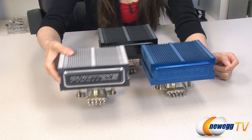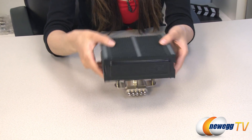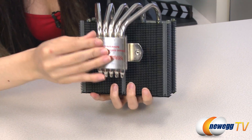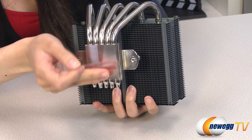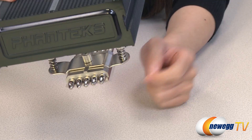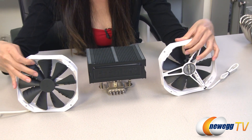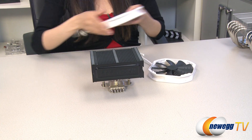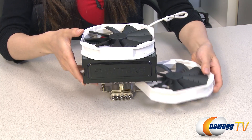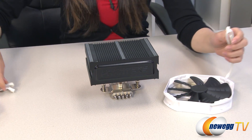Here's another look at the heatsinks and their various colors — the white one, blue one, and finally the black one, which is my favorite. It comes with aluminum fins, five copper heat pipes, and a copper contact plate. They've also included a mounting bracket that is compatible with all sockets, so you won't need to remove it. Here are the two color-coordinated 140mm fans that come with the heatsink. You can mount one on the bottom as well as one on the top, or for clearance issues — such as if you want to include taller DIMMs — you could remove the bottom one.